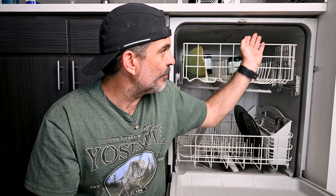Not enough or no water going into the dishwasher. I've seen this happen a lot — tickets where the water is shut off or restricted and there's just not a lot of water entering the dishwasher. Sometimes this can be as easy as turning on the water under the kitchen sink. Other times it's more advanced troubleshooting, such as a faulty inlet valve. This is a very easy one for the homeowner to diagnose — just start the dishwasher, listen for the water running, and open the dishwasher to see that everything is soaked. You'll be fine opening it to check while it's running; it's not going to flood your home.